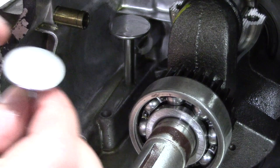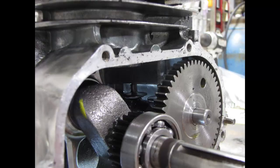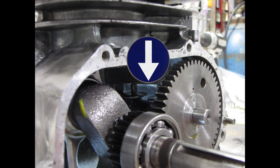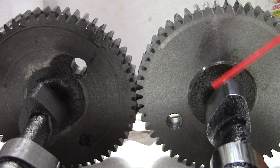So I'm using assembly lube — that's what you're going to need to install these before you break your engine in. Assembly lube has special ingredients in it that keep the parts from wearing too fast before they mate together. And if you look closely, the lobes on the camshaft are touching the lifters there.